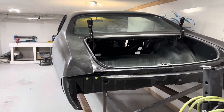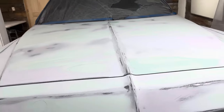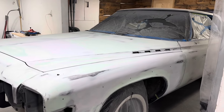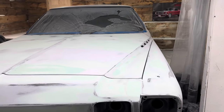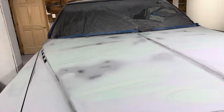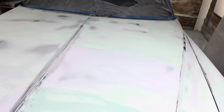While we're having the class, some of the guys in the shop will be working on these other projects. This is the 74 Buick Electra that we've been working on. It's been back here for a week or two getting bolted back together, panel fitment established. It's been epoxy primed and we're on to filler work — actually getting close to being done with filler work on this. Our panel-to-panel is looking nice, our gaps are looking nice, and we're getting close to getting another round of primer on this one.